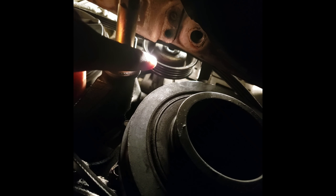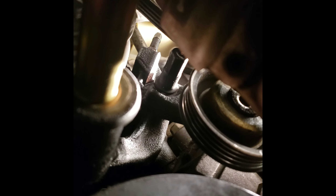So the hardest part of this entire job is to adjust the bolt that is for that pulley in the middle, above this mount beside the compressor clutch and the harmonic balancer. You have to get a socket — I'm going to show you — to loosen that nut right there. Once you loosen that nut, this pivot point on the pulley will allow it to drop down further when you back that out.